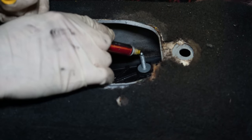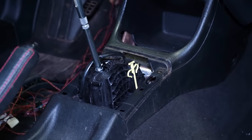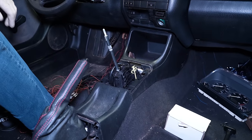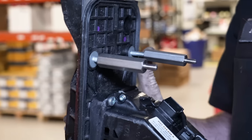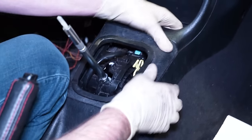I then marked the shifter housing mounting studs with paint to see where the holes need to be drilled. After installing the Mark 7 shifter box into the car, I quickly found out that it sat way too high in the center console. To fix this, we added standoffs to our shifter box to lower it down. This allowed our shifter to fit beautifully so we can move along with our project.